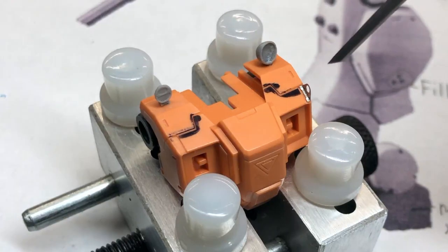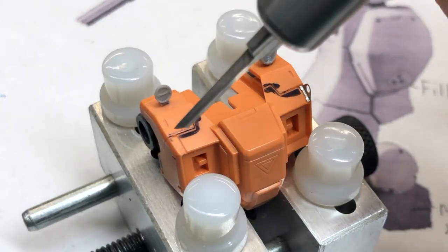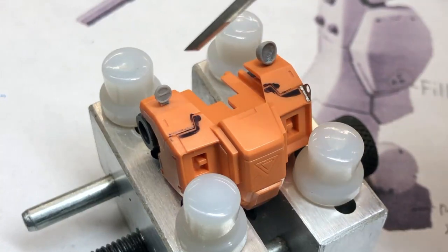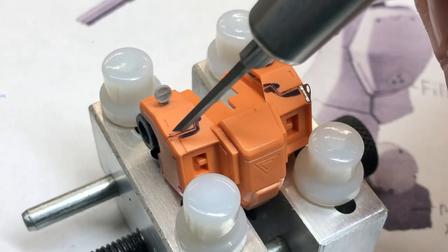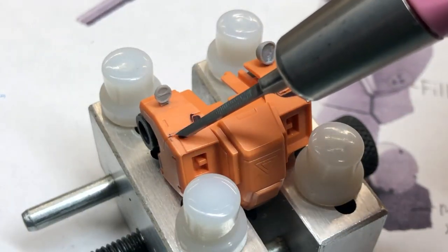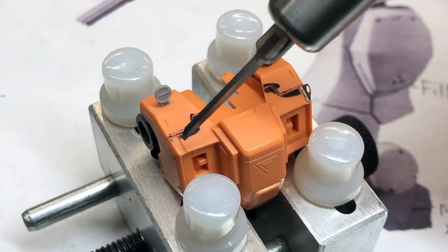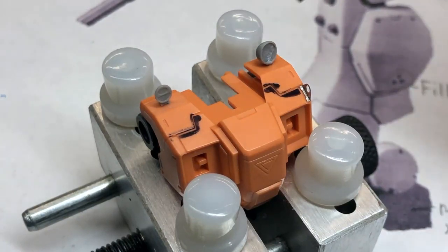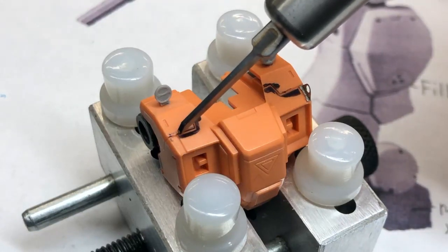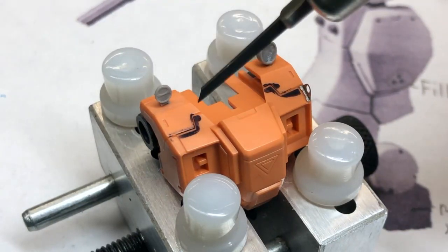Once that's laid down, a really big piece of the technique is you want to let the tool do as much of the work as possible. When you put your panel line scriber down, I really tried to take my time and go slow. I made sure my feet were planted firmly on the floor, my arms were relaxed, my jaw was relaxed — I tried to check in with myself and make sure there wasn't tension all over. I would just slowly drag, and it really just became a very meditative process. If I were to count the strokes to get this tiny channel, I'd say offhand it was probably 30 strokes.